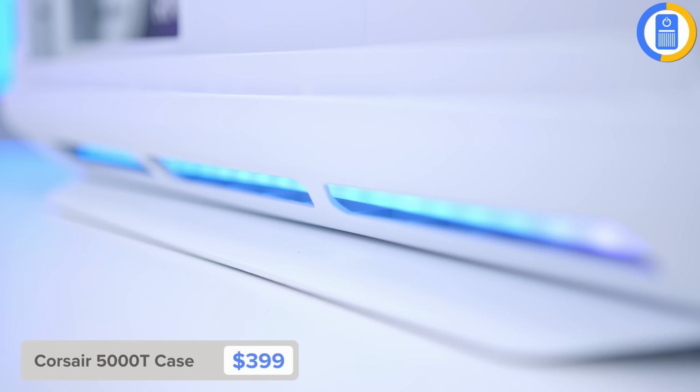In terms of the CPU, the Intel 13th gen chip I'm opting to use is the i7-13700K. Now there are a couple of options when it comes to processors. If you're purely going for a gaming build, the i5 can save you some money, and if you want an editing-oriented system, the i9 is the best bet. The i7 though is a great middle ground, and with our 4080 graphics card, you do want to be careful you don't bottleneck it with an underpowered CPU.